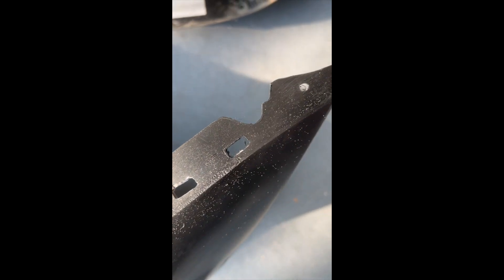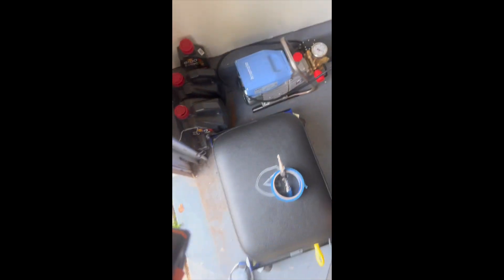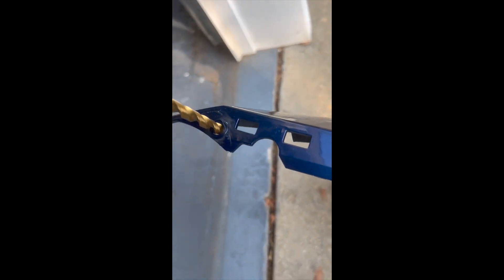What I'm doing now — I don't really think these ones matter too much now that I'm looking at it more. I might just touch those up a little bit and drill them. This is a 5/16ths bit — make sure you find the metric equivalent too. All you have to do is match the Tesla one. That's pretty much a good fit. It's a little bit smaller than that but I think it'll be just fine. So I'm going to go around and drill out these holes a little bit bigger.